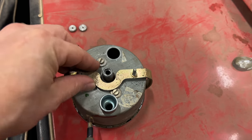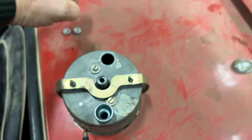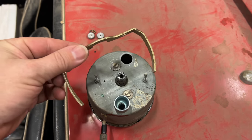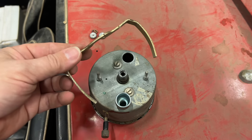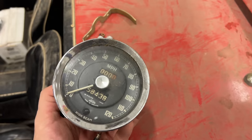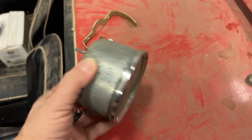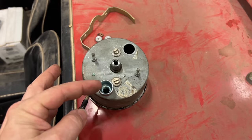I have to get these lock washers off first, and then this bracket just clamps the gauge onto the dashboard. This is pretty much how it works on almost all of the British cars from this era and older. So if you have a problem with one of your gauges, it's actually really easy to pop out your tachometer and speedometer from a car like this.